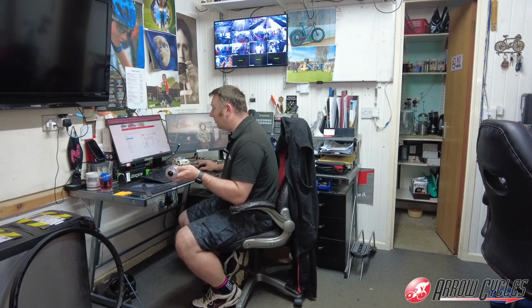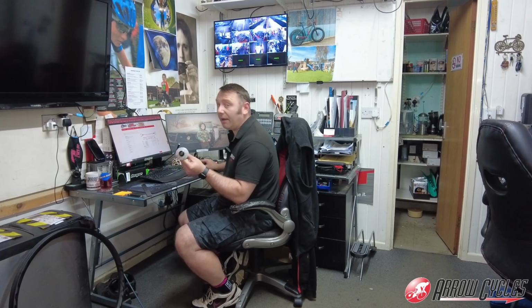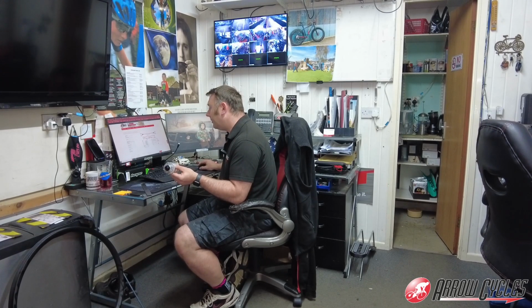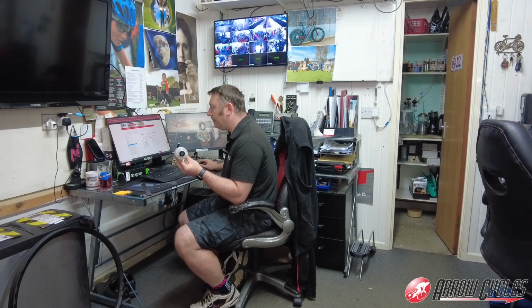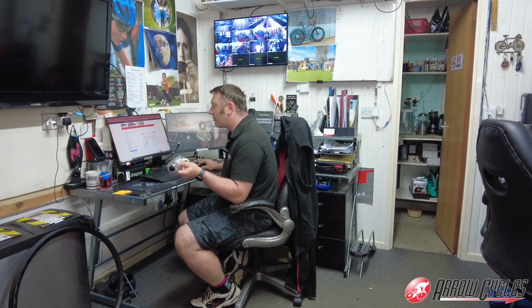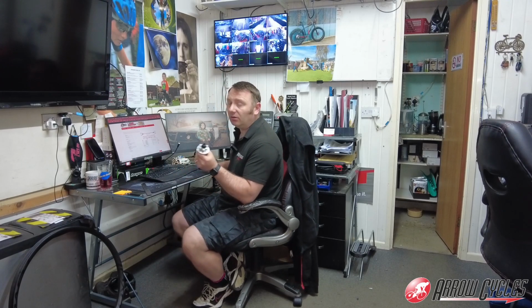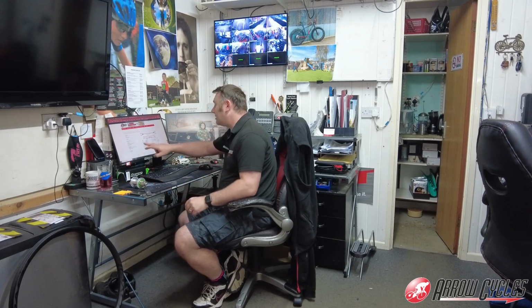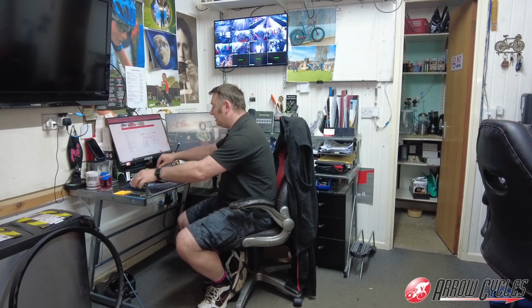This is obviously the rear hub. The front one again would need to be measured separately. And we've got a Hope, and this is a Pro 4 Boost, so it's 148 mil, and we're going to use a 3-cross lace pattern. We'll touch on that in a short time. So that has now populated all of our sizes.